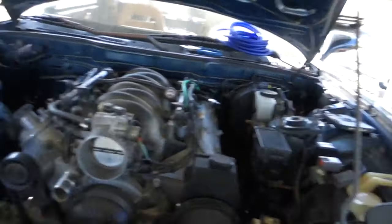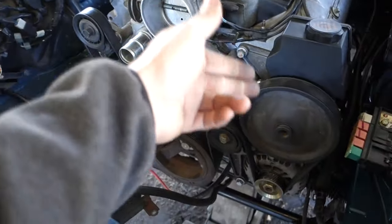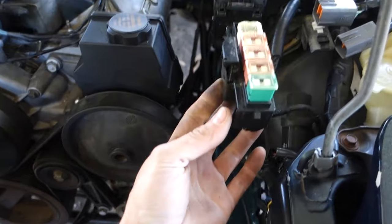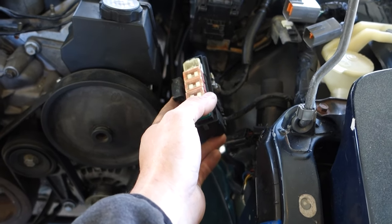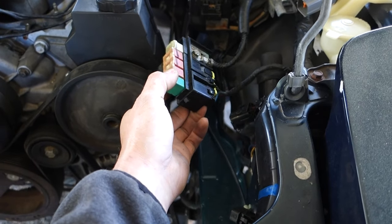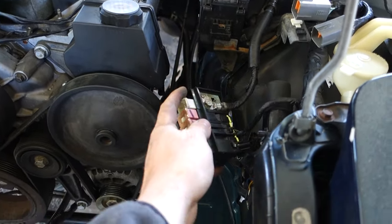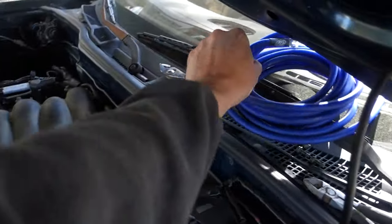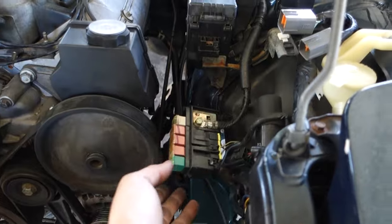It's been a couple of days since I last recorded, but we got the engine in. Right now I'm working on the main power side of the car — hooking up the starter, alternator, and battery. This is the power block where everything comes together. I relocated the battery in the back a while ago. I'm going to connect the starter and alternator to one side of this power block, and the battery power wire to the other side. That's where the car gets all its power from.